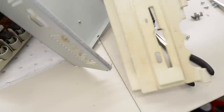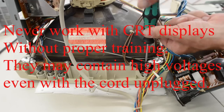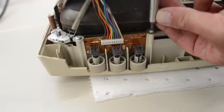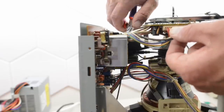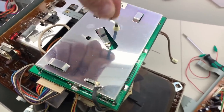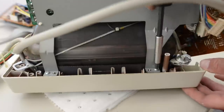This case is just absolutely disgusting. Now let's see if we can remove this shield with the PCB that's stuck on its side. This seems to be the power supply. Take pictures of every connector when you take something like this apart, because it will make reassembly way quicker. Next we have a small PCB with adjustment pots for the front panel, and it comes off. There are tons of cable ties. Let's see if we can remove the neckboard next — it seems to be held in place by a zip tie, which I've never seen before. Let's cut that off and hopefully replace it with a standard zip tie. And now the neckboard comes off.